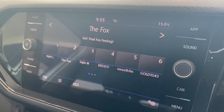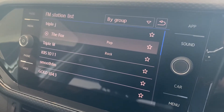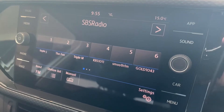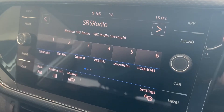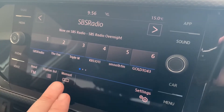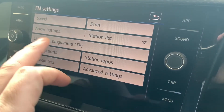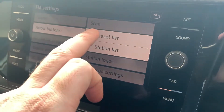If you wanted to change your presets, click on station list, select a station you want, tune into it, and then just push and hold the button for that preset number. You've also got extra options down the bottom — you can change the bandwidth, manually tune in, and there's a settings option. I'd suggest in settings, where it says arrow buttons on your steering wheel, set it to run through your preset list rather than the full station list to make it easier.